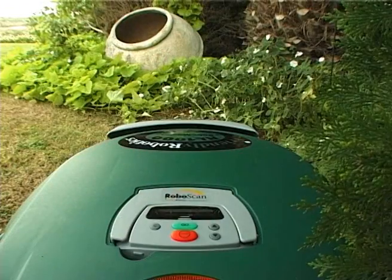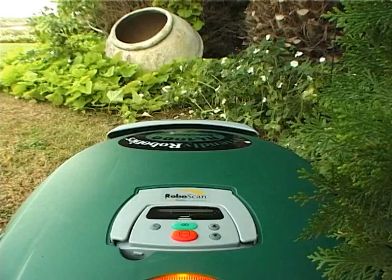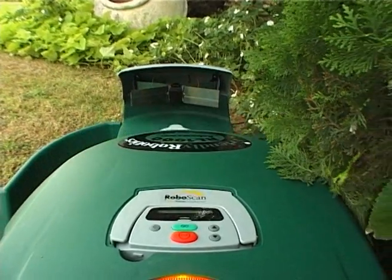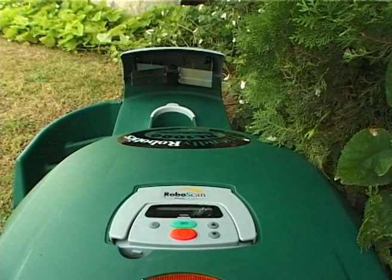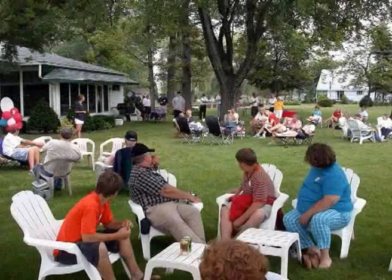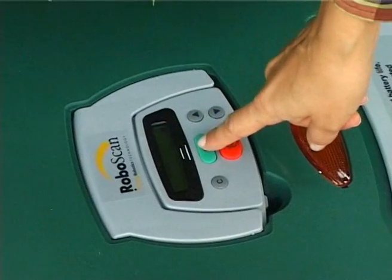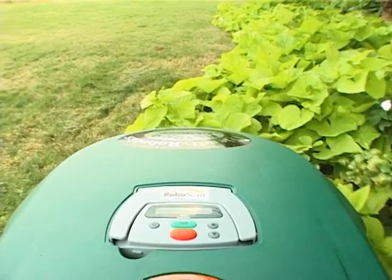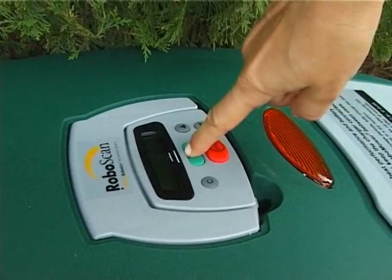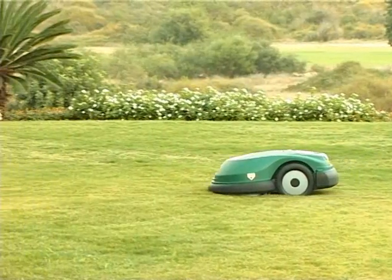Manual Depart. This mode can be used in addition to or instead of the weekly program, and allows mowing at times other than when programmed, or mowing when the lawn is occupied and the yard must be cleared of debris, objects, pets, or people first. Press the Go button once to mow the edge and the inner area of your lawn, or press the Go button twice to skip the edge and mow the inner area only.